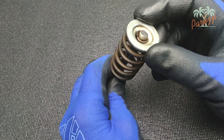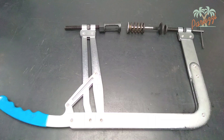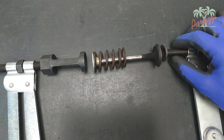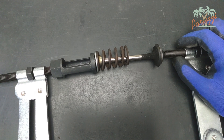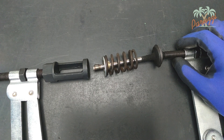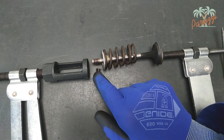To overcome the force of the valve spring, you will need a special tool: a valve spring tensioner, or valve spring pliers. This model can be used for all types of engines and is also very affordable. The left-hand jaw is placed against the spring retainer, and the right-hand one against the head of the valve. You want the valve keepers to be well clear to loosen them, without unnecessarily compressing the valve spring. Here we show a simulation of how the valves are disassembled. Of course there is no pressure on the valve spring here; in reality the valve spring is squeezed between the spring retainer and the cylinder head under great pressure.